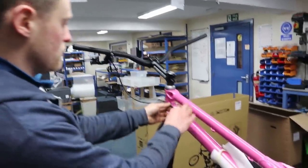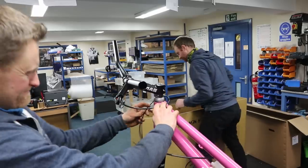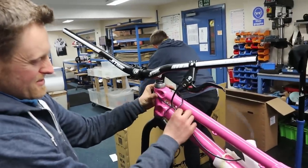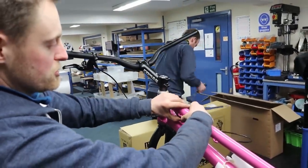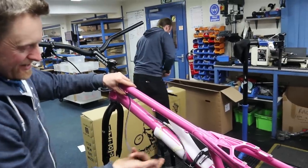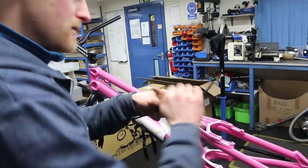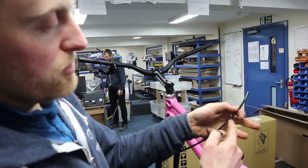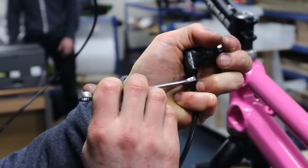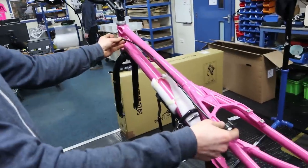Sizing up your hose — go with a full 360° bar rotation and then route the whole hose fairly tightly wrapped around the head tube; that's where you want to start from. It might look a bit ungainly at the front but it means you've definitely got enough hose to spin around. Get down to the back of the bike — the slave cylinder will be about there — add a tiny bit for good luck and snip it off. A lot of the older fittings have a six-millimeter thread and an eight-millimeter thread, so your shroud and olive go into the eight-millimeter thread. Keep pressure on the hose at all times so it stays pushed into the cylinder or lever while you fit it.